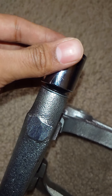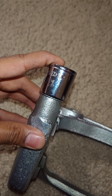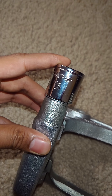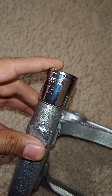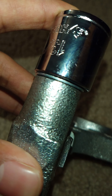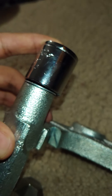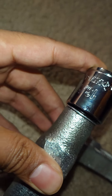What you would do is place the socket over like that, and then basically the method is to just hammer it in with a couple of light taps, because it doesn't take much force to socket it in. When you see the metal meet the caliper's metal, that's how you know you're finished — you should have a uniform gap around.